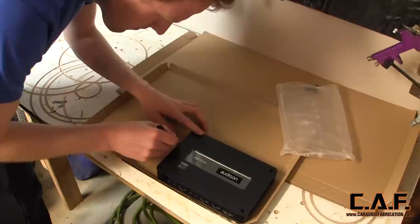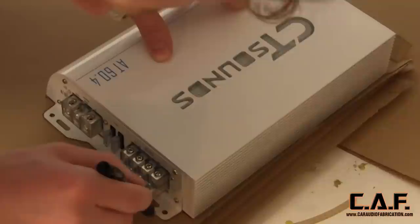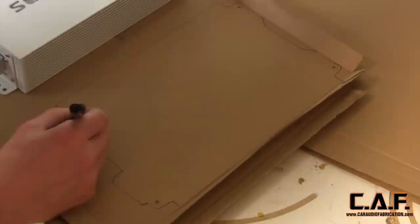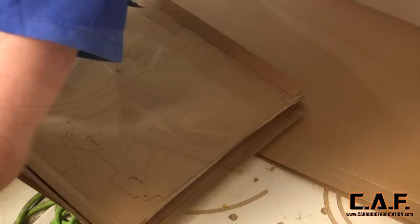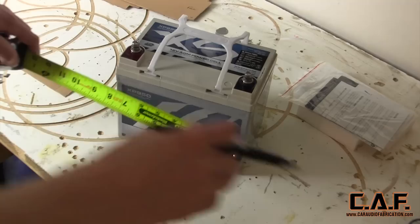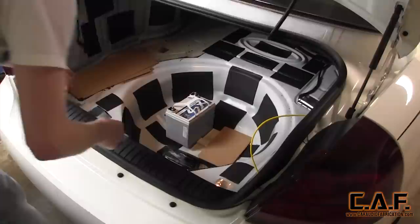To begin planning out our trunk install, I start by creating a cardboard template of each different component of the install. These templates allow me to move items around and test different locations without fear of damaging an item. This is a practice you could adopt for subwoofers as well — you'd create a side profile view to test where they would fit within a vehicle. Here I'm also labeling where the power wires go along with the speaker and signal wires so I can plan out my wiring layout. Since the battery has much more height to it, I'm simply recording its dimensions, though you could also make a fake box out of cardboard or wood so you don't have to move the heavy battery around.